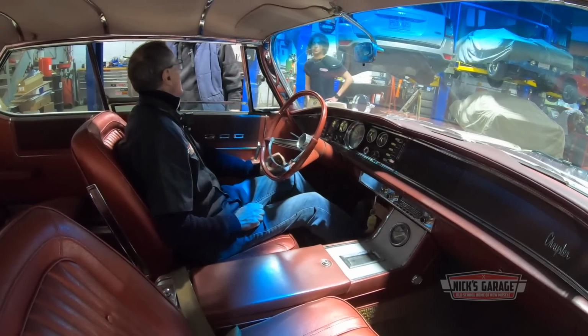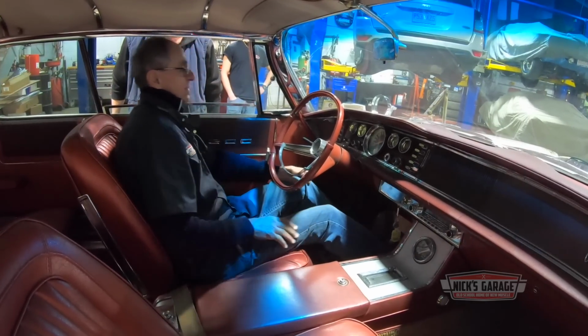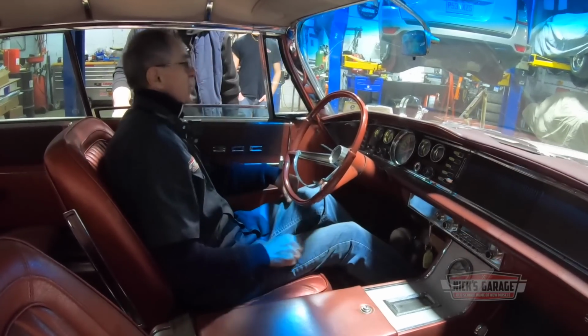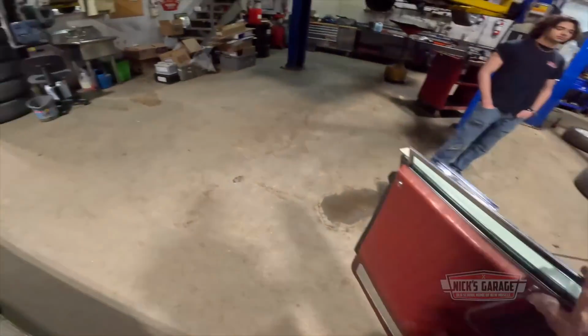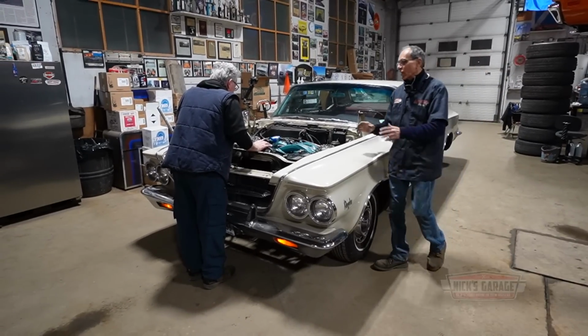What do you have it in, first or drive? You know what I think? What's that? It's the timing. Yeah, it's possible. Take off the vacuum, advance it mechanically, and do it like that. Here, I'm gonna show you. You want to just take off the vacuum? No, take off the vacuum. I'm gonna advance the distributor. Don't forget the timing backs up, right?